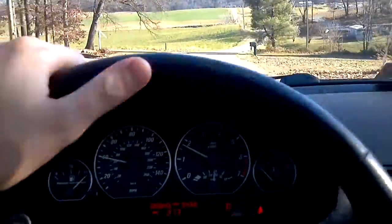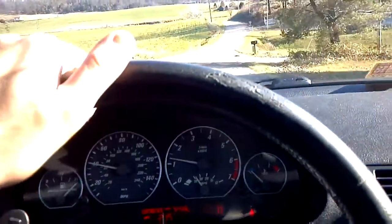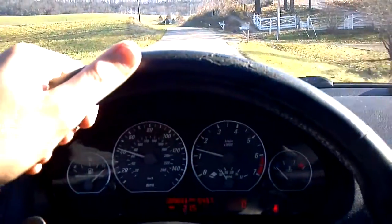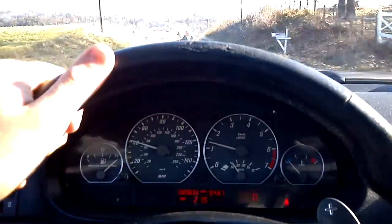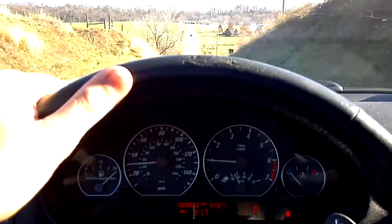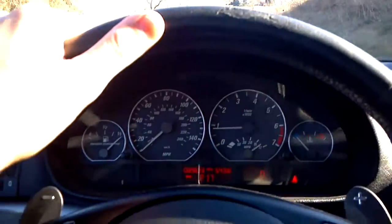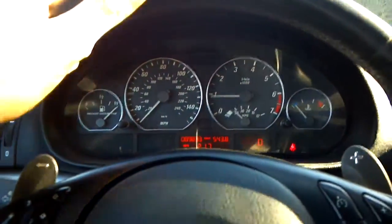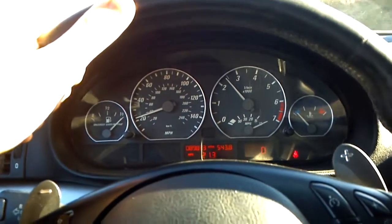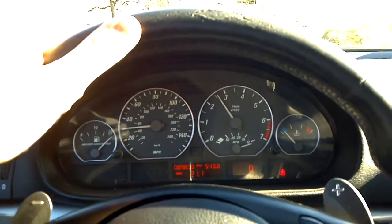I'm pressing smooth on the accelerator and you can hear it kind of dip and jump — going from accelerating smoothly to dropping down in RPMs. I'm focusing on the RPM gauge so you can actually see that. I'm going to give it one more from zero to going, and you can see it idles fine. There was a good dip.